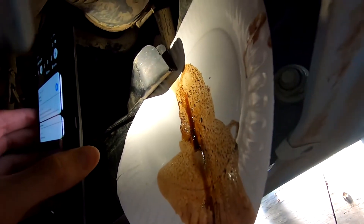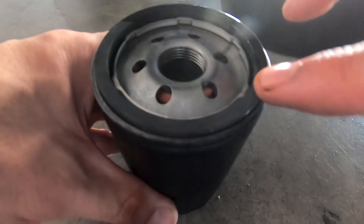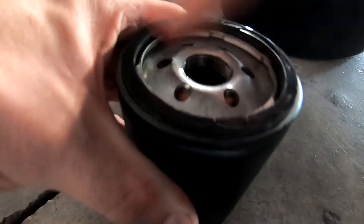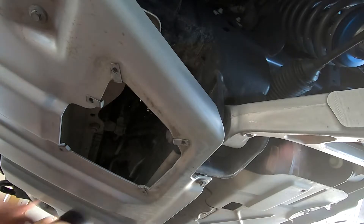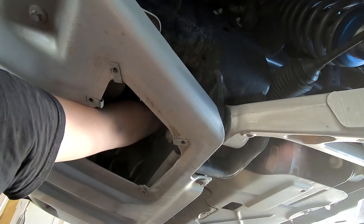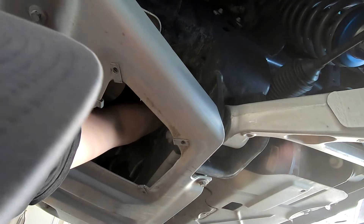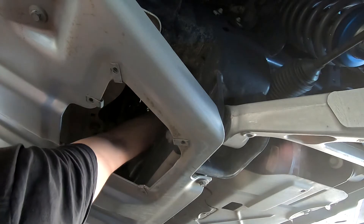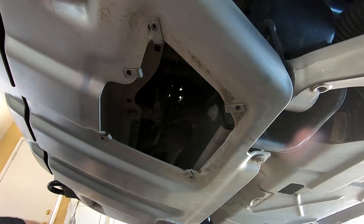I like to lubricate this little gasket right here — just lubricate it up, put some oil on there and maybe a little on the threads. Now it's ready to be screwed on. Put your oil filter back on. For me I just like to hand-tighten it — that's all you're going to need. It makes it easy to remove next time. Just get your hand in there until it doesn't spin anymore. And that's it. Now put your little cover back on.